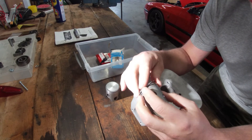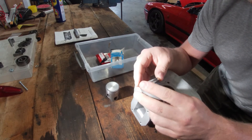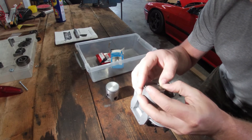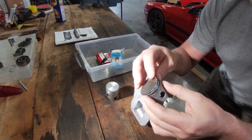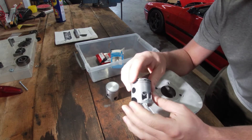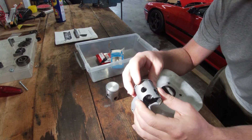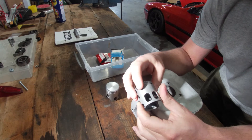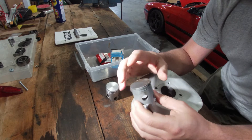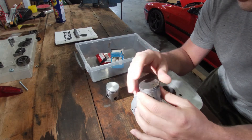So the plan of attack for now is to run the old piston. The guy in the shop also said it actually looks fine — the side walls are good, so if the piston rings seal up okay there should be no problem. I'm going to try and look for another piston. I've been looking around — maybe the piston for the latest model RD, I think it's the MX, has a piston that might fit. But I could already tell by the pictures the transfer ports are square, so that piston will need a lot of modification. But I will definitely investigate that. So the plan for now is to mount the old piston — sadly with the new piston rings — but I think it should be fine.